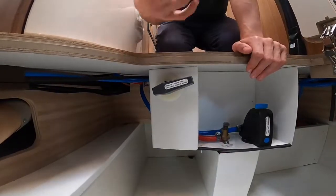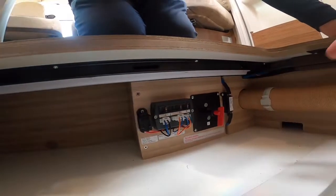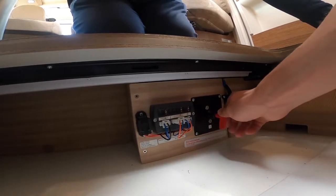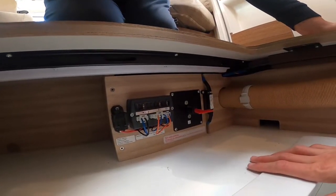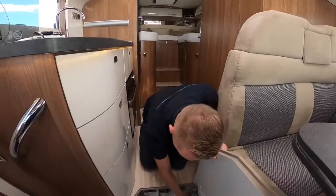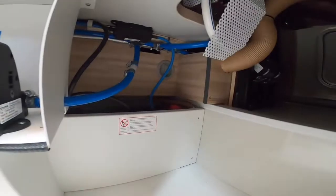On the opposite side you've got your leisure battery isolation switch. If you're standing the vehicle up for more than two weeks, it's recommended you turn the key from 1 to 0 — you can remove the key or leave it in, but it'll stop your leisure batteries from going flat. In winter still recommend charging your leisure batteries, as the cold can drain them — if they go too flat these new batteries won't take a charge, meaning you'd need to replenish the leisure battery, which is located just in the corner here.